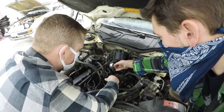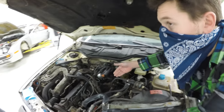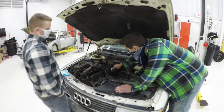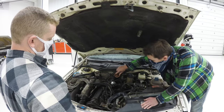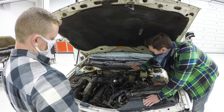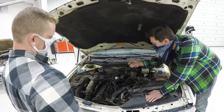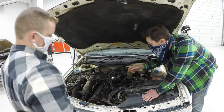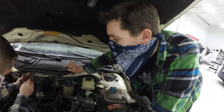Yeah, this can be wrong entirely. But that's still not changing the fact that it's not sparking all the time. I just meant you could eliminate this from the equation by going from here straight to a coil and seeing if you can get it to repeatedly spark. So if it's charging the coil, you can manually discharge it instead of waiting for this wiper to come around, in which case, you know, obviously these things wear and the gaps get wrong and they don't make contact with the coil, so I mean, you can never tell by looking at it.